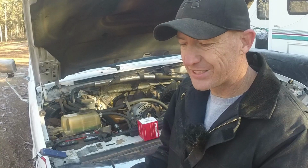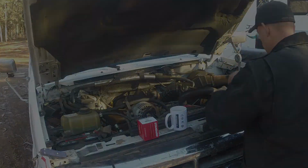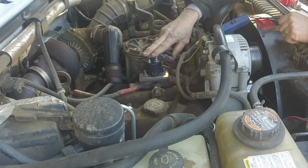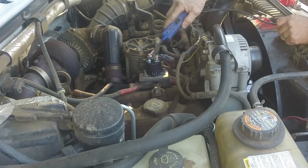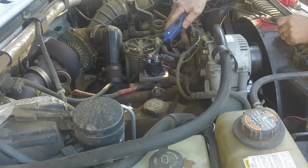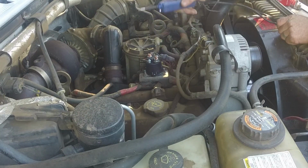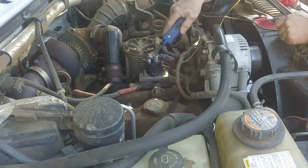So we're dealing with a relay that has constant power. First thing you do, disconnect your batteries. It's easier than trying to hold that constant power wire up in the air to keep it from touching something else. So we've got the new relay hooked up. Constant power, negative because the ignition isn't turned on, and negative because there's no bridge yet. When I turn the ignition on, this should go hot. Let's go ahead and test that theory.